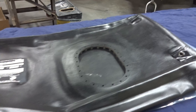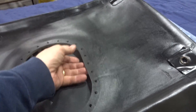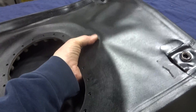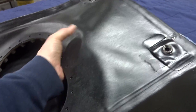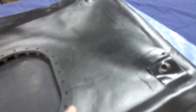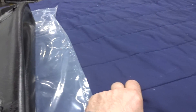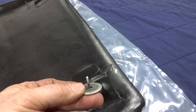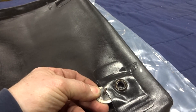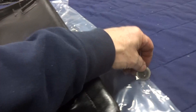This is a new fuel cell, and what I want to show is just how pliable it is. It's nice flexible rubber — it actually has a fabric in between a couple of plies. It's very, very flexible. It's held up into the top of the wing by these clips, which go in underneath and then clip into a receptacle on the top of the wing.